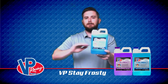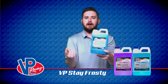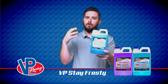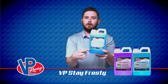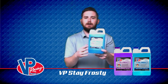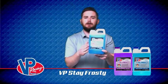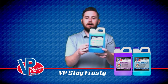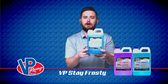This product has absolutely no glycols in it. So you get a more robust surfactant group of additives in there. So it's more concentration on the wetting agents. You still get that same corrosion protection that the other product does, but we're mixing it with an RO water and absolutely no glycols in this. So this is race ready, race legal, and we are able to make some pretty substantial temperature reduction claims.